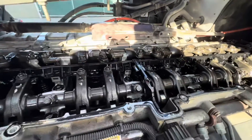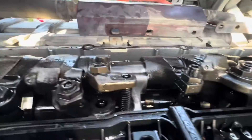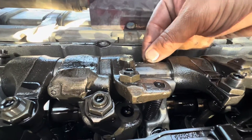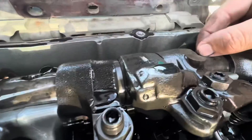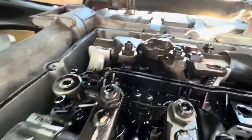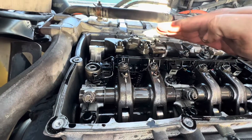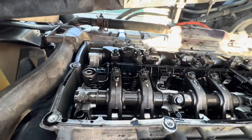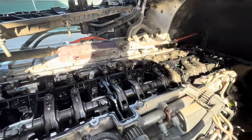But sometimes you've got to get dirty and figure out what's going on. Wow, look at this — if you can see the difference, this is sticking up a bit more. Look at that — this is actually loose. Look at that wiggle. That's not good at all guys. This entire rocker arm is actually kind of lifting up. So we're going to put it to time, loosen everything up, torque it all down. Hopefully that will resolve our issue.